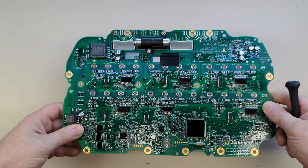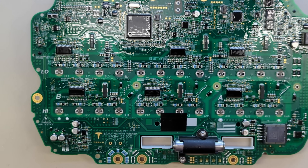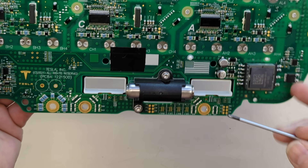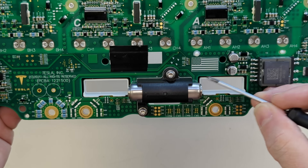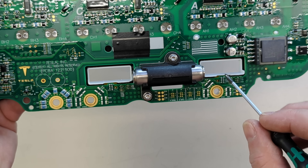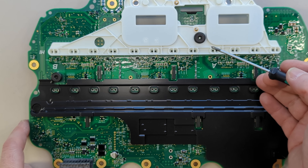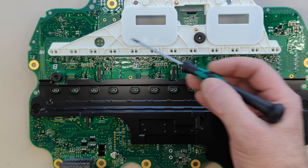Let's get to the printed circuit board. On the back side we have this plastic plate which, among other things, supports the current sensors here. This is basically either a flux gate or a Hall effect current sensor — probably a flux gate. There's a core surrounding this that's held in by the plastic, and you can see the sensor connections here. They're only measuring two phases because they can get the current on the third by the difference between these two.